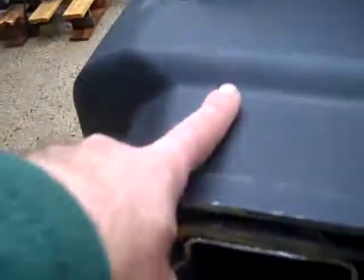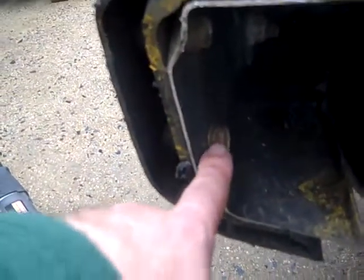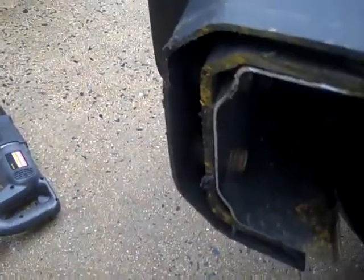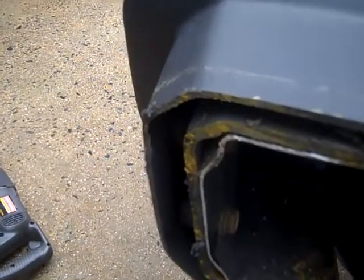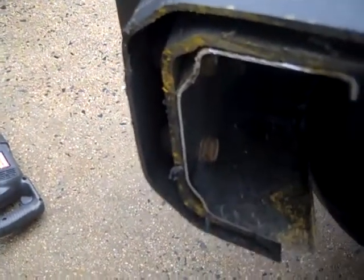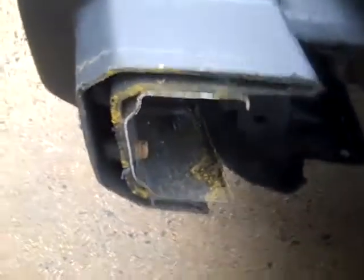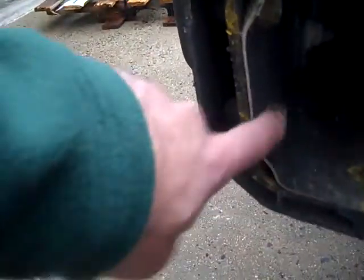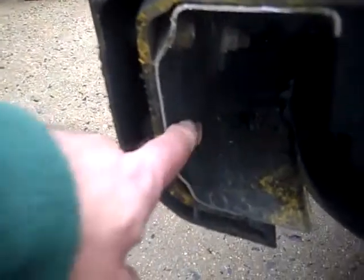What I want to show is how close, at 3.5 inches off of the hub here, it takes you to the mounting bolt for the bumper itself. So that's one of the mounting bolts for the bumper. There's a solid 1/2 inch left, so if I take another 1/4 inch or so off, I should be okay. And notice now that we've got exposed metal, so we'll be priming and then painting the edge just to control the rust. Not really worried about it, because at some point we'll be going with steel bumpers, but for the sake of doing it right, we'll prime it and paint it to control rust. But be mindful of these mounting holes on the back of the bumper, so that you don't try to drill through one of these bolts.